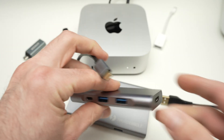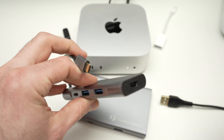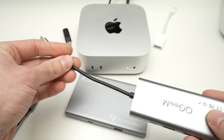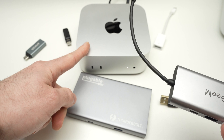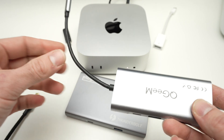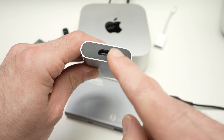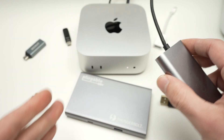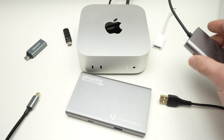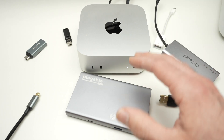You need to be careful when you select your dock. Some of them have an HDMI port and you think you can plug another external monitor to your Mac Mini M4 that only has one HDMI. Well, it's true, but many of them — especially the cheap ones like this one — only accept a monitor connected at 30 Hz. Which means that if you intend to use that Mac Mini to game or even video edit, it won't be enough.